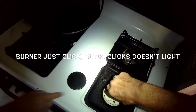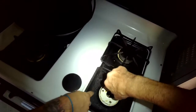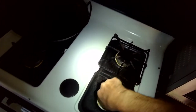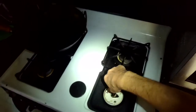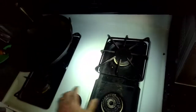You're going to pull off the burner cap and then look in to find a small brass piece with a little tiny hole in the middle. Then take something pointy, push it in there, and wiggle it around to break free all the debris that might be keeping the gas from coming out with the volume necessary to have a strong flame and to light.